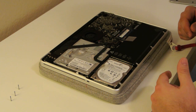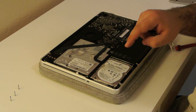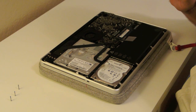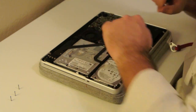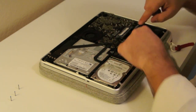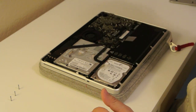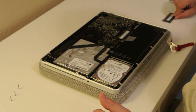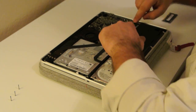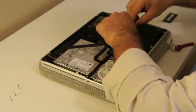Underneath here we have the motherboard fan, the hard drive, and then you have your battery right here. You just pull apart on those two little tabs right there. There are two little tabs and you just pull apart, and then you just pull the memory out and set that aside. Then there's another set of tabs — you just pull them apart and the second one pops right out.